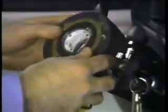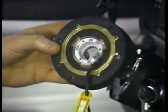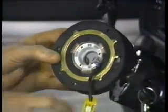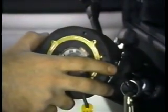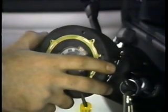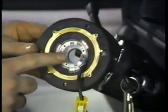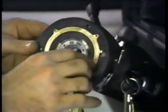The spiral spring stays attached to the top of the steering column stalk switches. If the spiral spring is removed, there are a couple of things to check when you reinstall it. First, check to make sure that the wires from the spring assembly are routed correctly over the top of the steering column stalk switches and are not pinched. Next, make sure that the spiral spring is in its center position — to do this, rotate it accordingly.